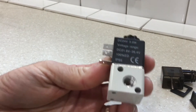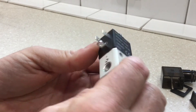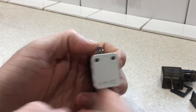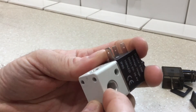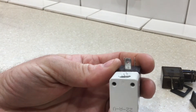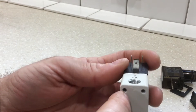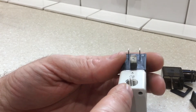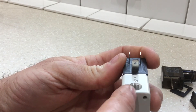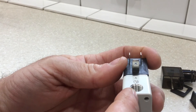It should go in just like the existing valve did. The supply will come in here with the right angle fitting. There's a plug in the other gallery on the end over here, and then the outlet will go down to the fan clutch. The biggest difference between the valves is that the outlet port on the other valve is not eighth-inch national pipe like the inlets are — it's a smaller port size, so it uses a different fitting.